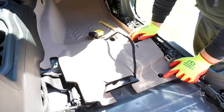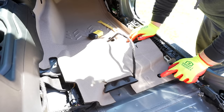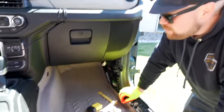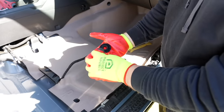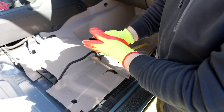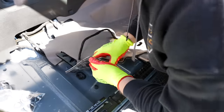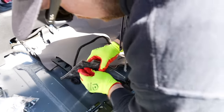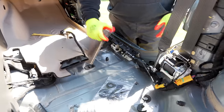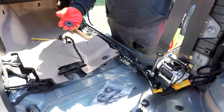The front's crucial because you don't want this sliding. So once you're happy with that, we're going to go around and check out all the rest of this. Make sure we have it all tucked under, get the wiring to pop out, and make sure it's firmly pressed. We can repeat the process on the other side. We'll grab the pieces inside - this is what's going to clip this down into the flooring. They give you the OEM style clips. I probably should have done that before we put it in. Here are the two pieces you're going to use in order to snap around the carpeting and get it to snap into the OEM location.